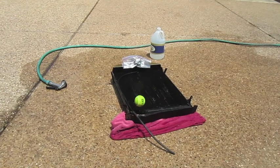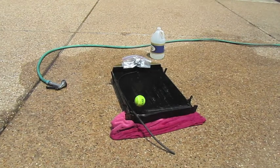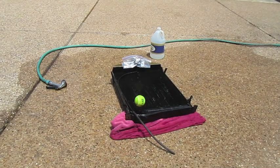This part is optional for the Model A radiator replacement, but I want to show you how to do a flow test on a Model A radiator. Basically, we will fill up the radiator with water and then drain it, and see how long it takes for the entire contents to drain. The literature says it should be about four seconds. If it's much longer than that, your radiator needs to be cleaned or serviced — possibly even repaired if it's really clogged. There's also a capacity check: if you fill it up, it should hold about a gallon and a half.